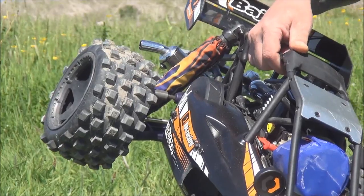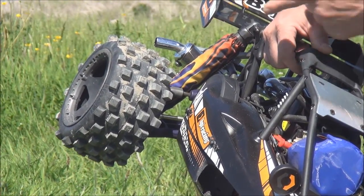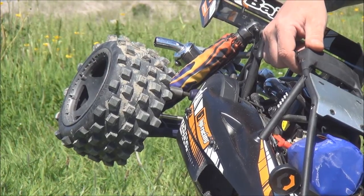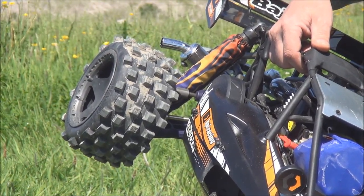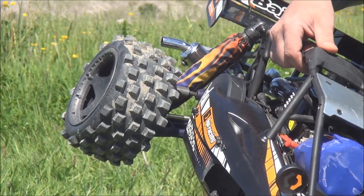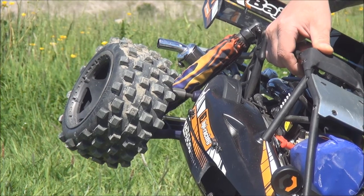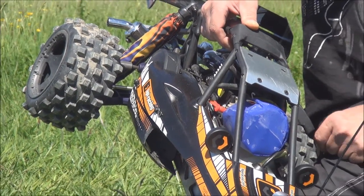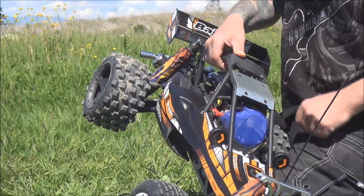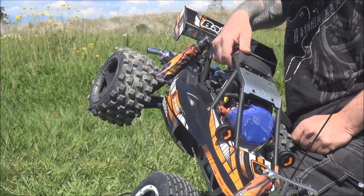The only thing that holds that axle in is that boot. I went through some brush, a few sticks went through that CV boot, and then the axle fell off. The axle fell down and got wedged in the bottom of the control arm, and then it just stopped dead. What I noticed about this car is both these tires have to have contact onto the ground with the axles intact, or it doesn't spin. I found that to be kind of interesting.